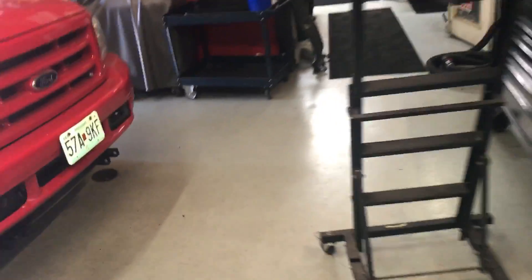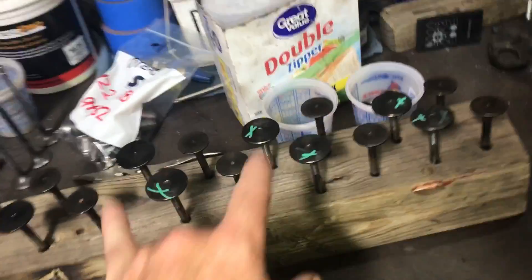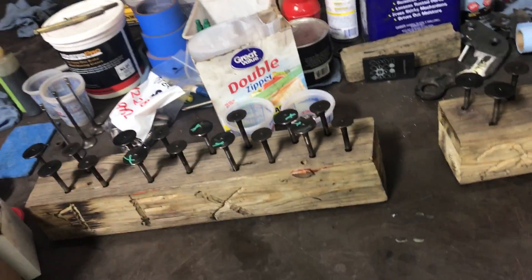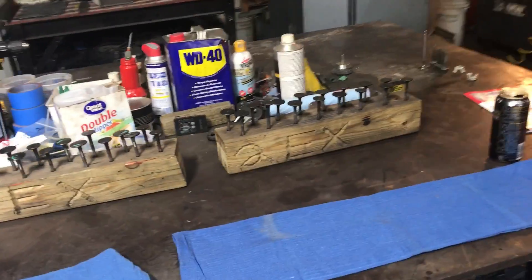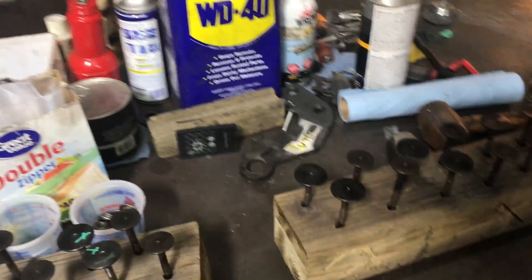I was going to come back here and touch off and reset some valves and have the heads ready, but it didn't quite work out like that. I've got all the valves out; I can put them back in their seats. I have these little blocks to keep them organized so I can break down a set of heads and put the valves back in their original seats. We lap all our valves in just to check — make sure all the seats are good, make sure there's no chatter, make sure nothing's wrong. Then I final clean, put it in the spray cabinet, clean those up.